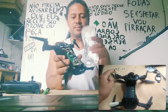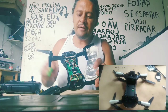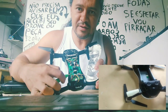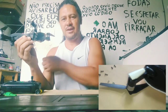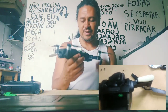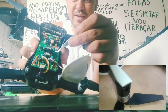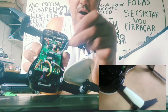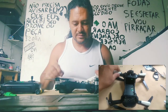Gyro is this part here. Gyroscope. If you turn anything here so bad, your quad flies in front with a good velocity and comes back so slowly. It's so dangerous. It's because of this we have some protections to make this small piece always aligned to the four motors.